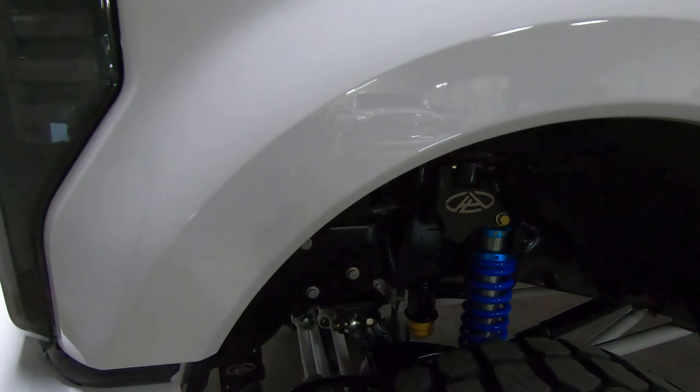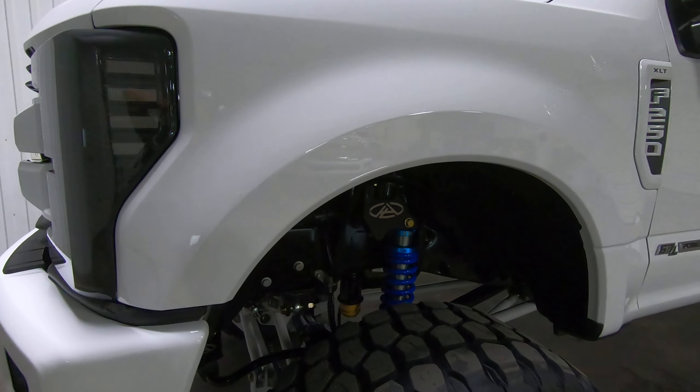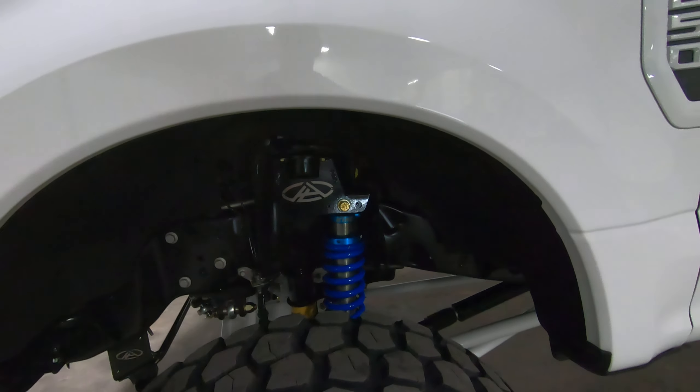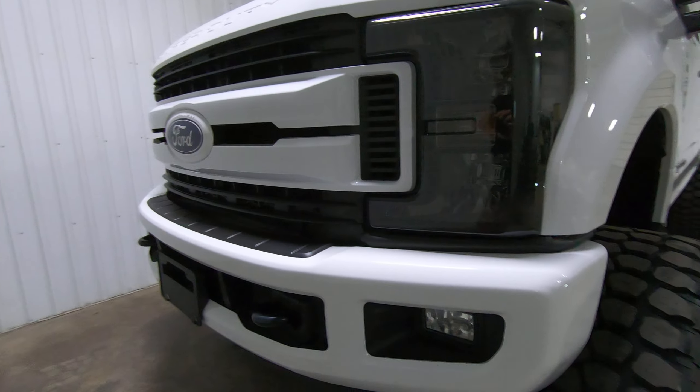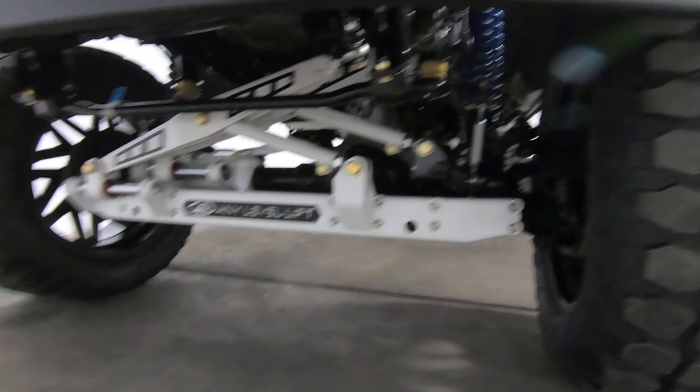The system is upgradable to go up to 13 inches with the driveline package and brake line extensions. It can also be upgraded to the hydraulic package, which is a fully automatic setup where you hit the switches and the truck will go from level all the way up to 13, or stop anywhere in between.